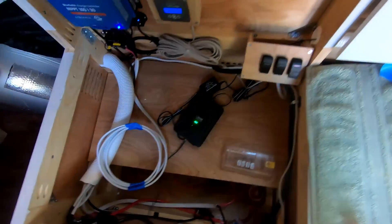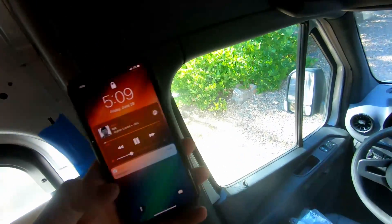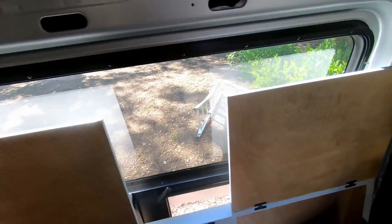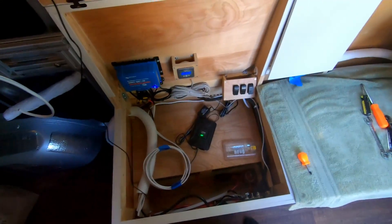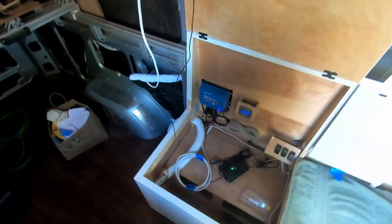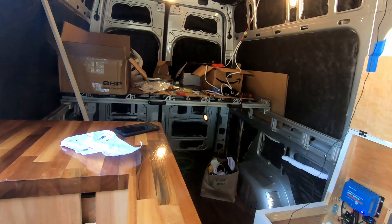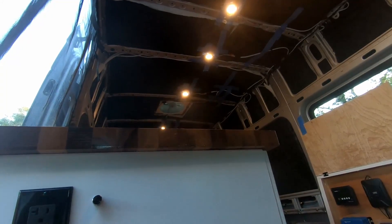We got a couple of new things installed. First, the WeBoost, which actually works pretty well — when I hold my cell phone close to the internal antenna I get about double the cell reception I normally do. The WeBoost is actually routed through a switch, which is pretty cool. Second is the fridge, keeping things nice and cool — I got my first couple drinks in there. Right now I'm doing DC so all 12 volt DC stuff is connected to this fuse box. You just pick the fuse with the right amperage and things are good to go. And I got the dimmer switch hooked up to the lights — lights are good to go.